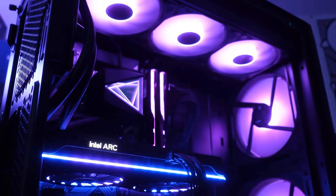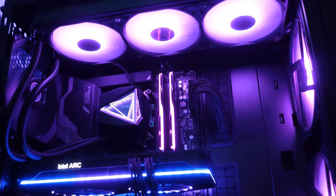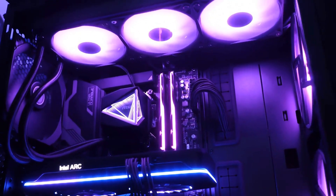At least if the connectors on your motherboard are both at the top. But if that's not the case, you'll need to use an adapter instead of cutting the sleeve, since if your RGB connector is underneath — as it's bundled with the fan connector — you'll need to split it up, which we really don't want to do. The water cooling tubes are sleeved, about 40cm long. For top or front installation there shouldn't be any issues, though bottom mounting could be more complicated. The radiator is 27mm thick and nearly 40cm long — a standard size for this format.